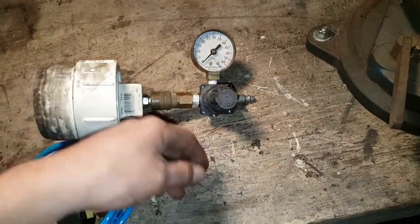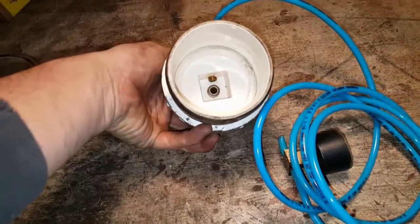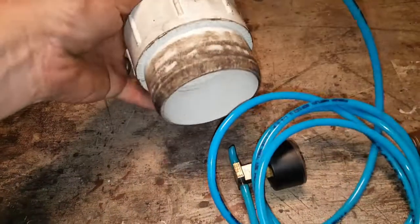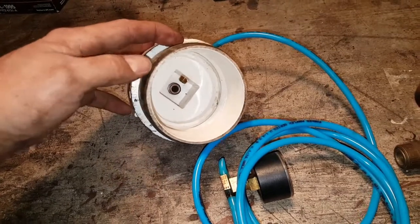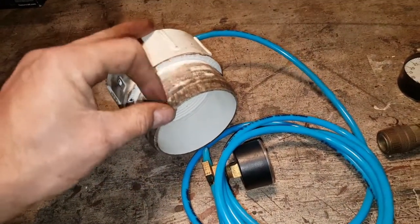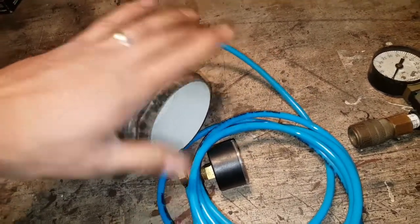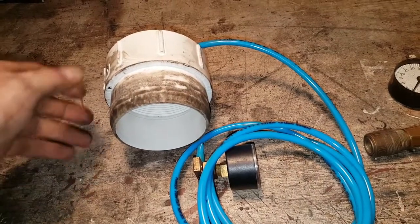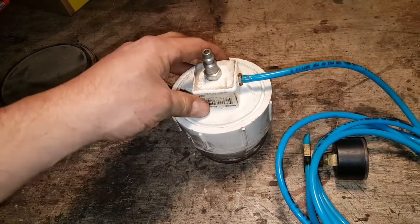It's just a used piece that I picked up someplace - air inlet, QD outlet. None of this stuff has nuts or anything on it. If you drill the right size hole you can just thread that right into the plastic. This is just three-inch PVC. I kind of leveled the end of it here and then scuffed the whole thing up with a file so it's nice and rough. You want to be able to really crimp down on that and not have it slip, because if that thing blows out with 25 pounds of pressure on it, it'll scare the crap out of you.